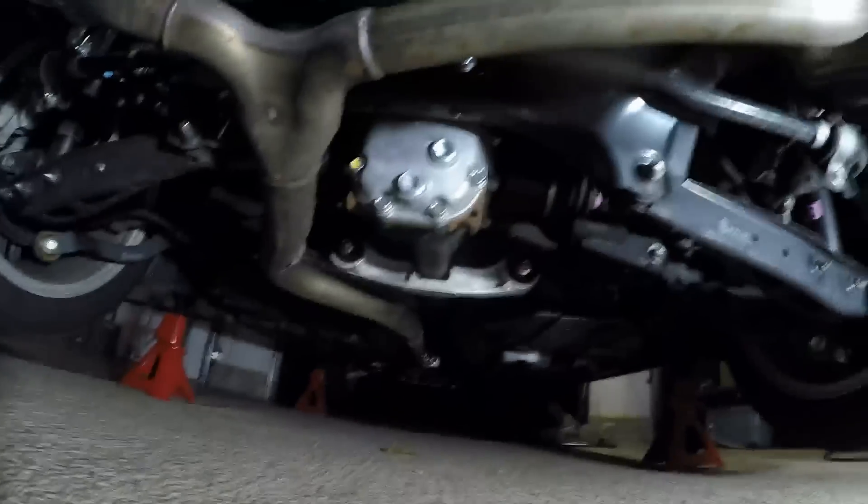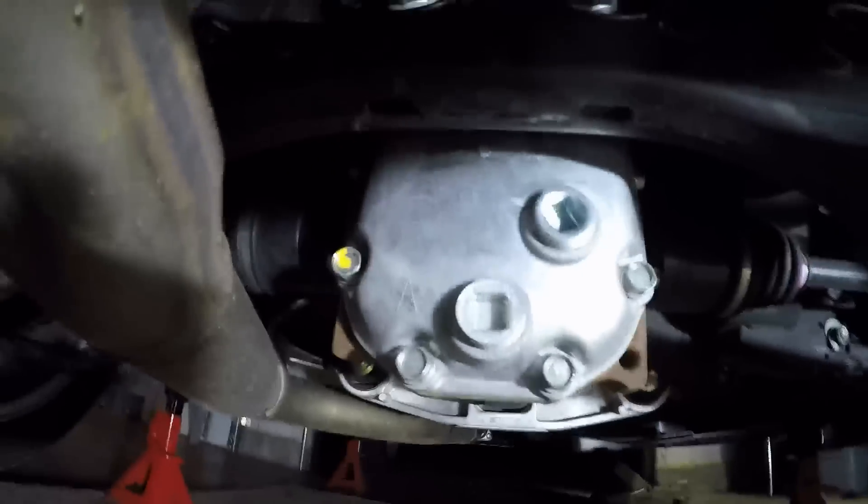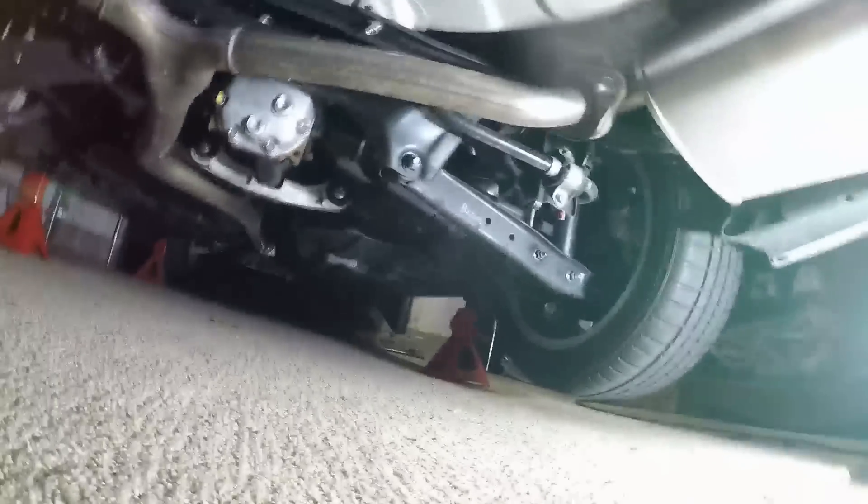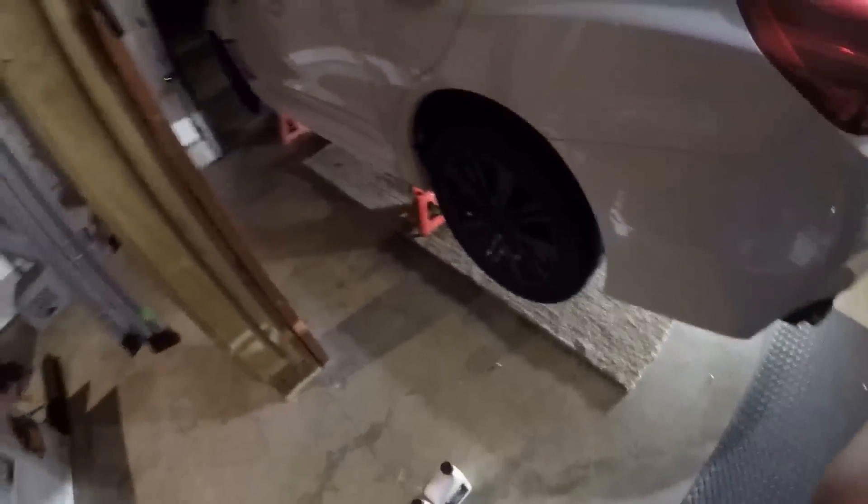I have a nice pump tool here which is pretty sweet. We're doing the rear end, it's 0.8 quarts. You just use your basic half inch ratchet. I do have the car up in the air, balanced on four jack stands to make sure I got the level right.